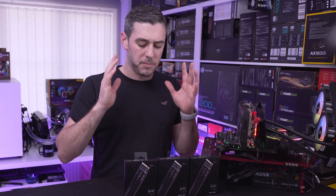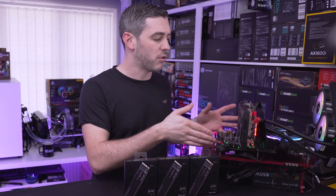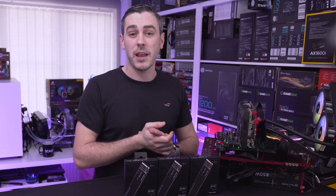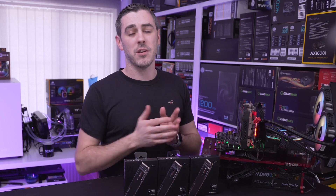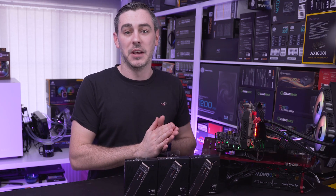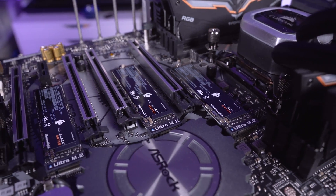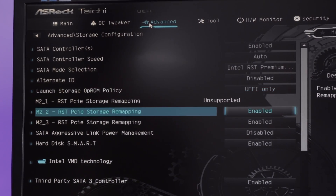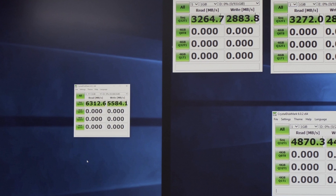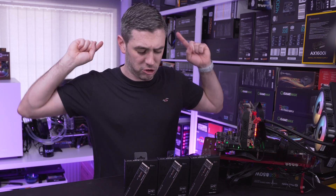If you haven't checked out the video we already did based around the three SN750s, I definitely invite you to go check that out. We essentially used the ASRock X299 Taichi XE. It had three M.2 slots and it said that it supported RAID. Well, it turns out after some investigation it only does that across two of the slots — number three and number two. Number one is basically a completely different slot that uses a different interface to interact with the M.2 slot. So what we did went completely out the window. We were still able to get some really good speeds, and we'll put them up somewhere in this video for reference. But this time we're going to go extreme.